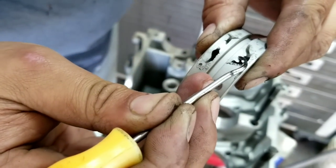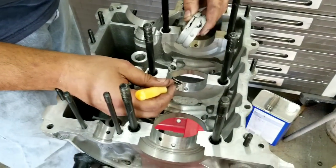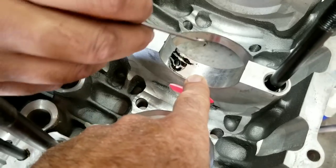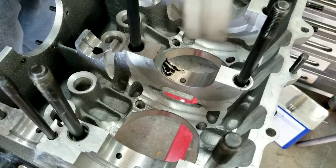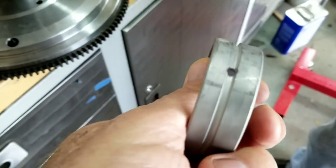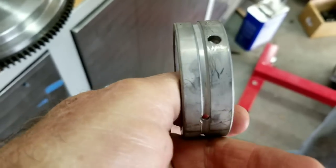You can see right there it's only half of the hole touching the bearing. This is the oil groove, and you can see how much it actually overlaps — it doesn't mate up with those holes because of the dowel pins. So you've got to make sure those are in your case as well. Just machining this little area right here is what corrects it.